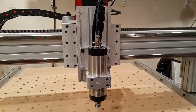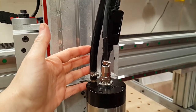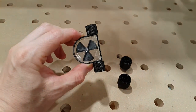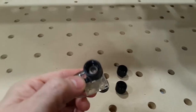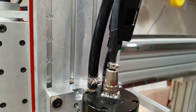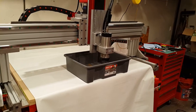The water-cooled spindle has been working really well, but it's driving me nuts — I have no flow indicator. With this black tubing I can't see into it, so I picked up this flow indicator wheel that rotates with the fluid. It comes with G1/4 threads, so I had to pick up G1/4 compression fittings that match the tubing size I'm using. We're just going to put this in line on the other side.